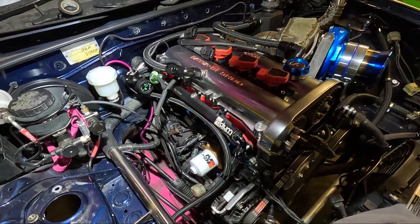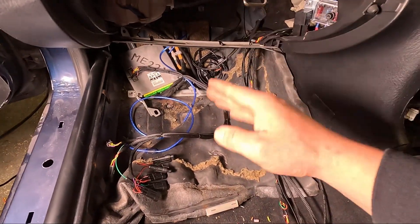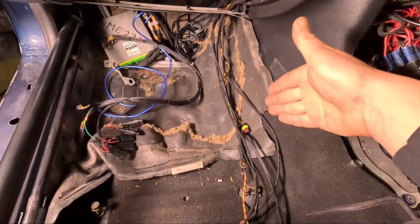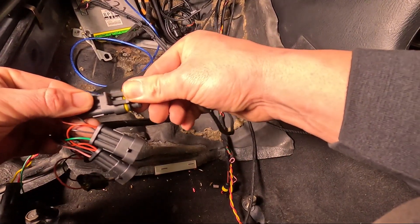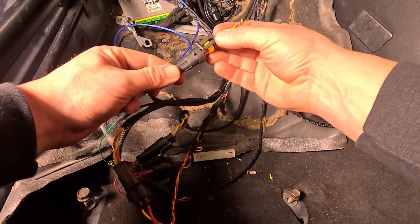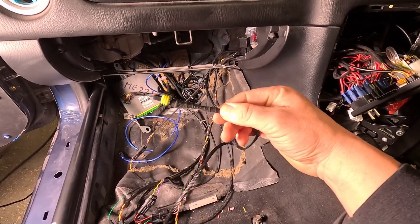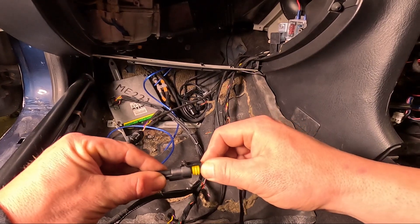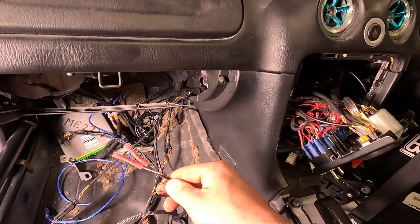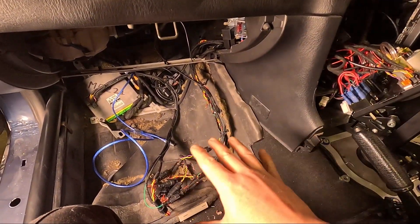It's time to connect these three sensors up to the options port on the ECU. It's a mess down here at the minute, but I've just got to trust the process. The patch lead I've made for the options port is plugged in, and all the wires coming from the engine bay are run behind the dashboard and into the passenger footwell. All I've got to do is plug them into the patch lead: fuel pressure, oil pressure, the new oil temperature sensor, coil pack 3 and 4, CAN high and low to the CAN check gauge, and the last one is the flex fuel sensor. The green digital input wire goes into the options port, and the flex fuel sensor's 12 volt power goes to the distribution unit. That's all connected behind the dash now, and the options port wiring is all finished.